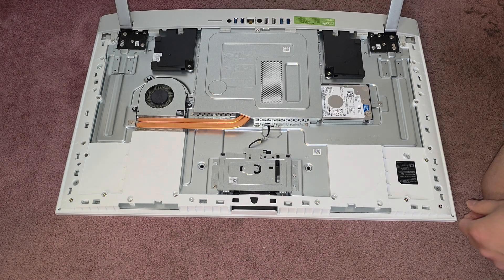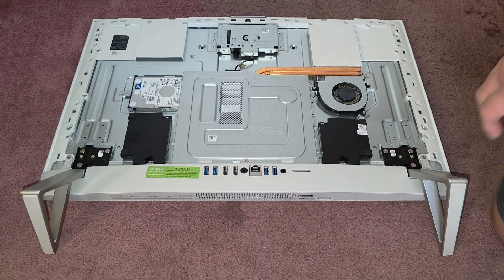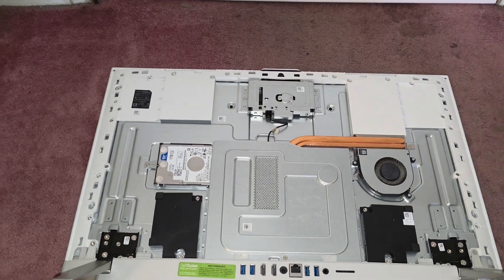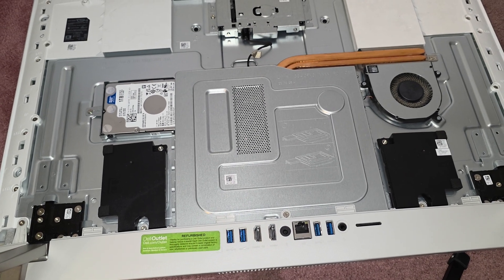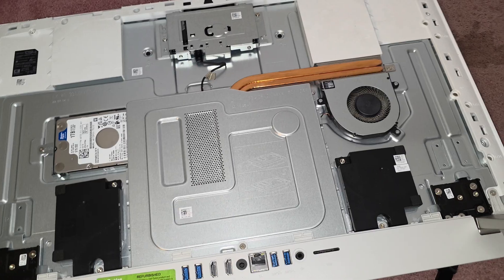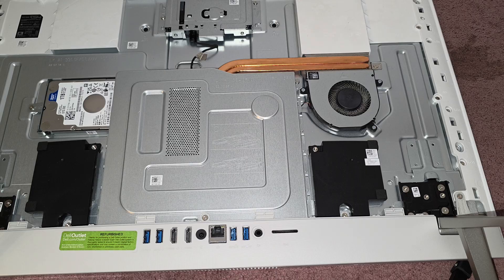Anyway, let's set that aside. The reason we're opening this is the computer is having some weird boot issue. The customer told me it just goes to a black screen — lights come on but it doesn't really do anything. So what we're going to check is if the BIOS battery is having some problems. They told me that when they got it to boot up, it would come on but it would show that the date and time is incorrect.